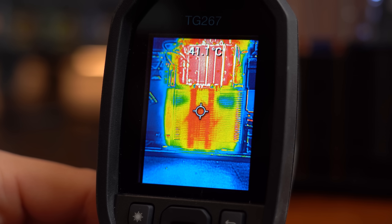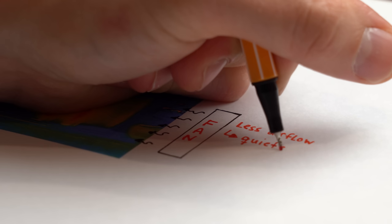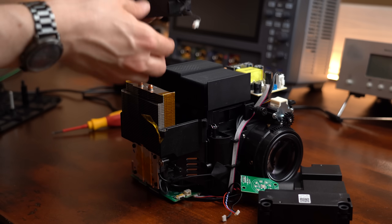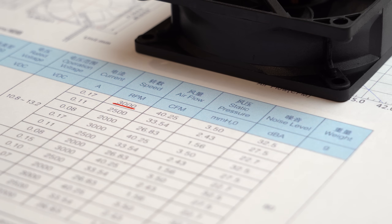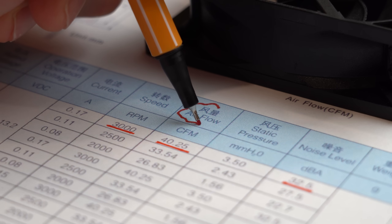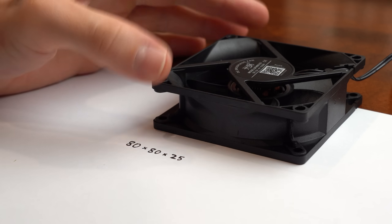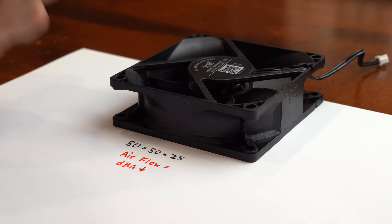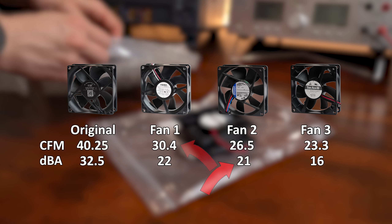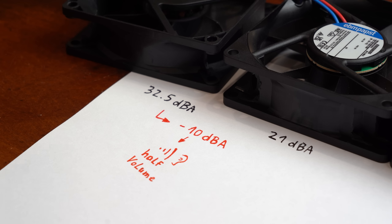What I also discovered during this test was that the outer fins still have room for more heat, and thus according to my theory we should get away with another fan that moves less air and is therefore quieter. So I dug deeper and took the projector apart to get to the loud fan. According to its model number it spins at 3000 RPM, creates an airflow of 40.25 CFM and a noise of 32.5 dBA. For our cooling capability we are mostly interested in the airflow — how much air we can move. The question is: can we find another fan with the same measurements that comes with similar airflow but less noise? I searched the internet and ordered 3 fans that all came with slightly less airflow but way less dBA. If dBA drops by 10 then it is like half the loudness for our ears, which sounded promising.